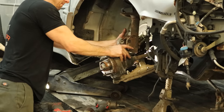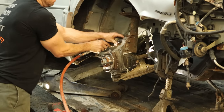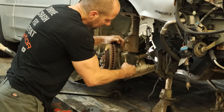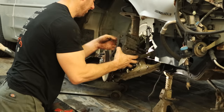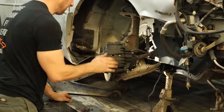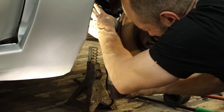Now we can put our knuckle into our strut — tap the bolts in there and tighten those up. Put our rotor back on, and put this little backing plate — not sure what it does; it's only on the newer Grand Ams, 2004 and 2005 I believe. Most of them didn't make it back on after their first brake job. Now we'll snug up our drive axle nut and torque it down later. Put our tie rod end back on there.